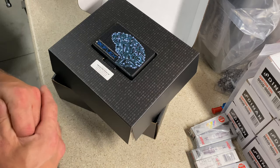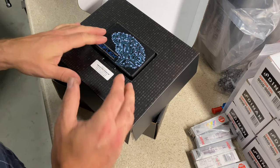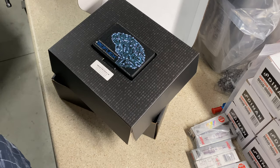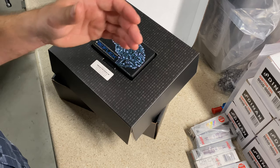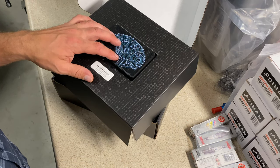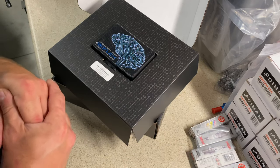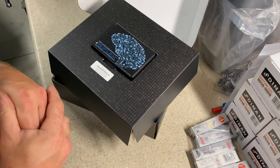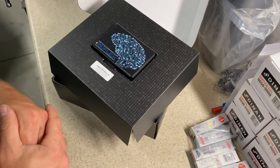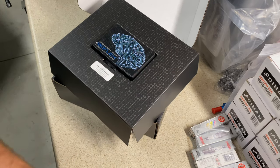I've already got the ethanol content sensor connected under my car, so I'll wire that up. Also, there's gonna be a pressure switch that I'm running on my port injection rail that will give a signal back to this. Rather than having just X amount of fuel going in, it'll basically be able to monitor the fuel rail pressure and then deliver fuel when it's needed. And that will allow everything again to run more smooth and consistent.